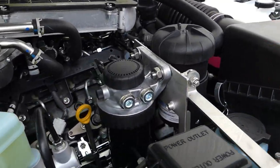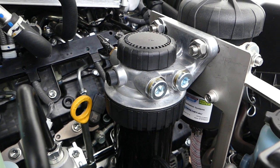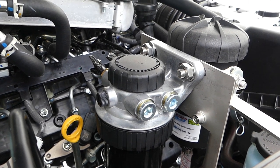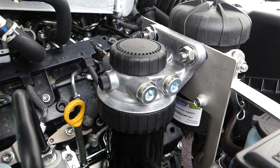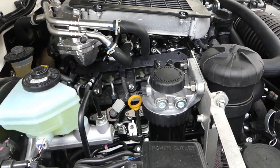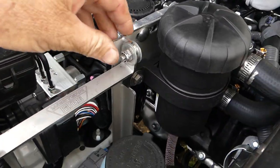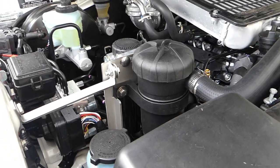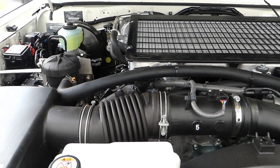I've also got a list on my phone — if I get out back Australia and get a bit of dirty fuel, I'll have a spare one of these filters with me. I'll also have a spare Toyota one for the other side, and I've got the part numbers. So if there's a John Deere dealership in the town we go to, I can grab a filter. If there's a Ryko Fleetguard, whatever, I can get a filter to get me out of strife. That's what's been happening under the bonnet. I got that stainless steel bracket from Western Filters in Sydney — that'll be a good setup. There's not much more going under the bonnet — once I get that fuel filter plumbed up, that'll do it.